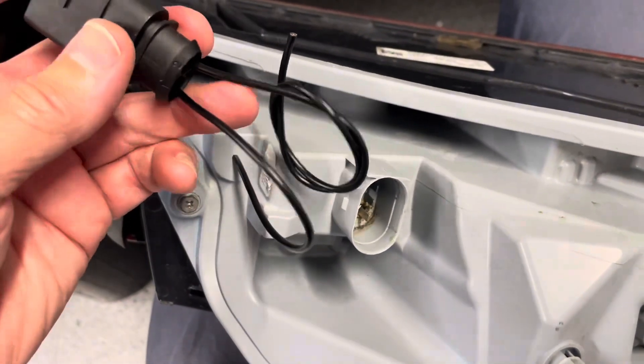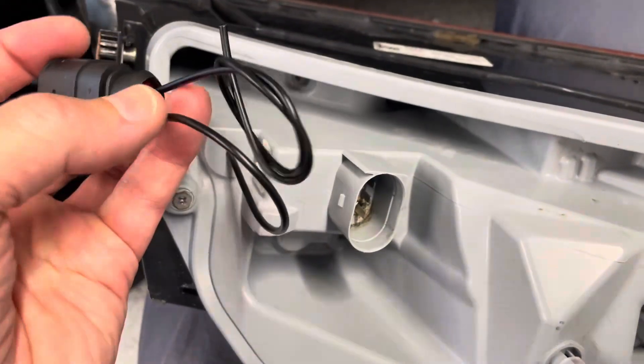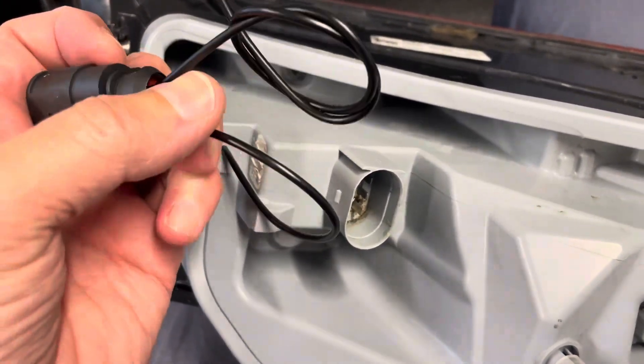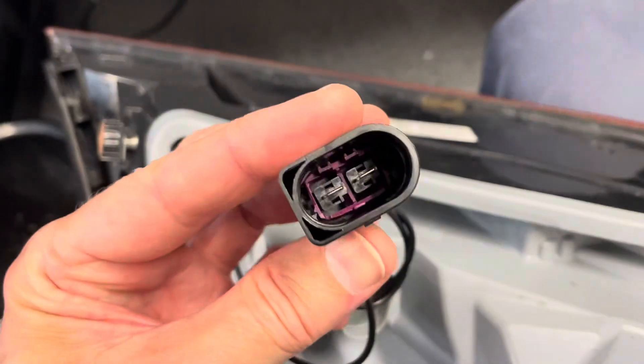I've had to put both wires in because if you don't, you don't seal the backs and you need to seal it to stop moisture getting in. So I've just cut a spare length of wire which I've put into one of the crimps — I could use that if necessary in the future — but pin one here I've made the earth connection.